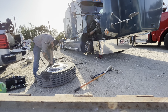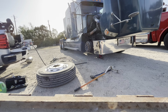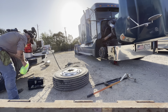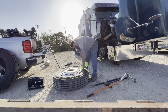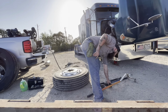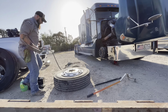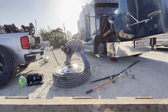This tool I have here is called a valve core remover. I'm going to remove the valve core from the stem and that will let all the air out of the tire. Now that the air is out, I'm going to use dish soap for lubrication to pull the tire off the wheel once I break the bead. This tool here is called a bead axe — I'm going to slap the sidewall of the tire until the bead breaks. Pretty self-explanatory. Now that the bead's broken, I'm going to flip the tire over and repeat the process.